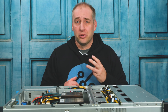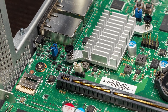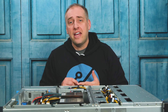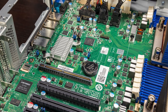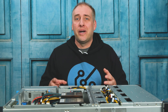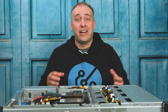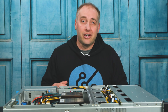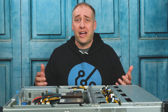Three other things to point out on this motherboard: we have a micro SD card slot, we have the Intel X550 10-gigabit ethernet controller under the heatsink here, and we don't have onboard M.2 storage. Of course, with all these low-profile and full-height slots, it's pretty easy to add M.2 storage on a PCIe card, and it's very inexpensive. I think that's the way Tyan is looking at you to customize this system — using a device that provides M.2 storage on a PCIe card instead of having it on the motherboard itself. You do have the SATA DOM slots as boot options, which is just a little bit different.